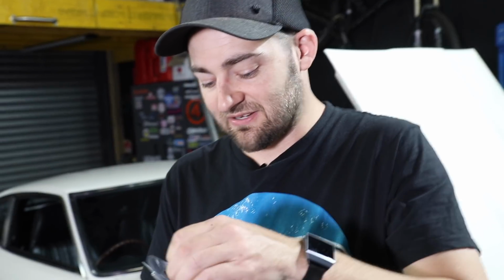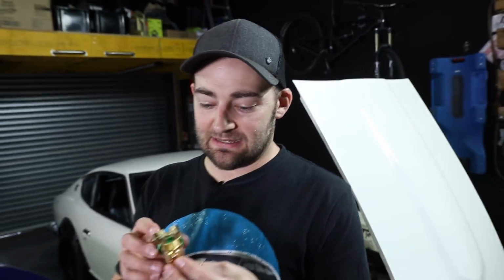The way this little thing works, it's technically called a battery terminal isolator. It is just a power isolator. It is just disconnecting the terminal. Now you've got to use it on the negative terminal because most cars are negative earthed. Old school ones, from earlier than the 50s, were positive. Don't put it on the positive side. Not a good idea.